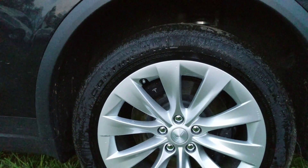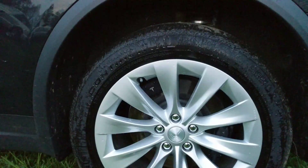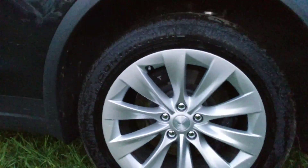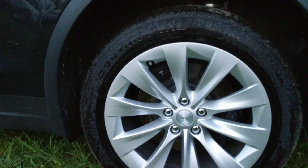But that's not recommended a lot of times, because the tires end up turning in the reverse direction of what they were. The tread can get feathered, and turning it in a different direction creates a lot of tire noise. I'll have to check the Tesla manual to see what they recommend, but you obviously cannot rotate front to rear like on a normal vehicle.